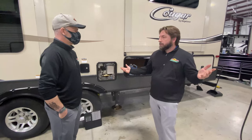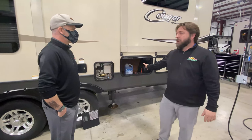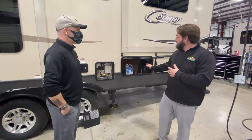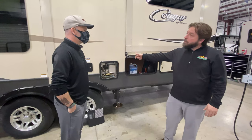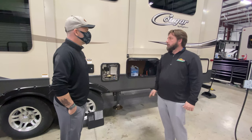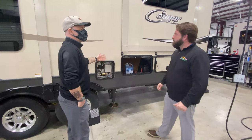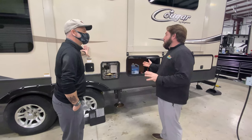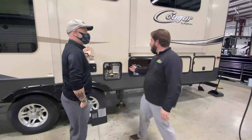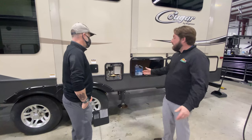Hopefully by now you've killed an hour or so. While you're waiting, walk around and look at your seals — check your roof seals, all that. The Spring Fresh can sit in there for a while, so there's no need to hurry. Once you're done, go ahead and flush all that Spring Fresh out with clean water. Then turn the bypass off on the water heater and fill it up — and make sure you do not turn it on until it's filled with water, or it's going to burn the element up and you won't have hot water at the campground. They're usually six-gallon or ten-gallon tanks — some twelve-gallon now. It only takes a few minutes to fill. Leave the pressure relief valve open and when water starts coming out, you know it's full and you're okay to turn it on.